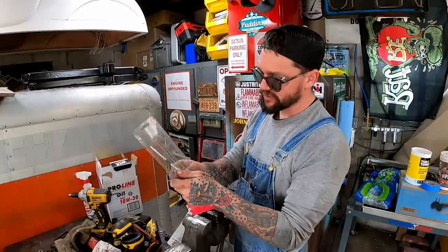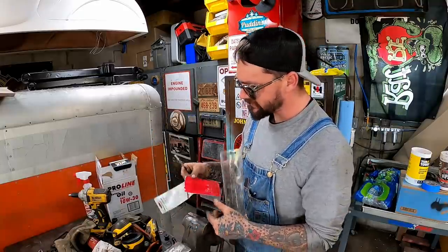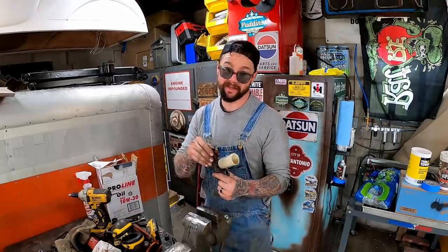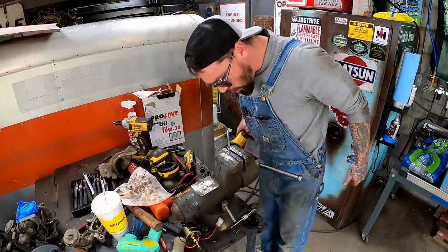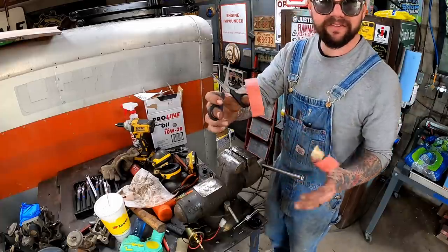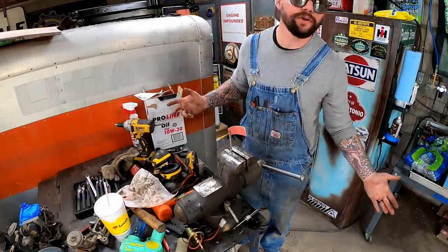I don't remember if it was Trucker Bob or Mr. Key who sent us out our little brake cylinder hone. She's gonna be slightly too big for this. Gonna have to get creative. Hell, creative's my middle name. Little slit in that. I found 220, so she gets 220. If this don't clean her up, that brake hone tool never woulda.